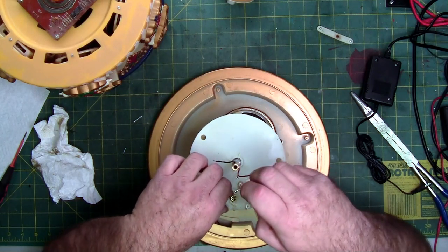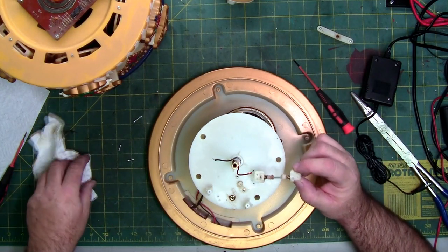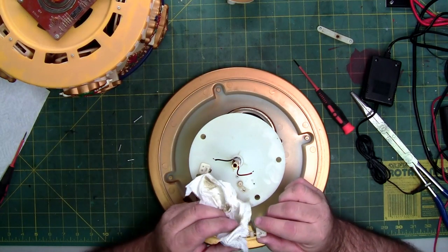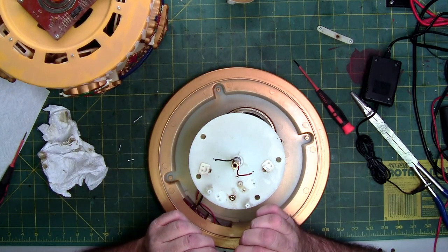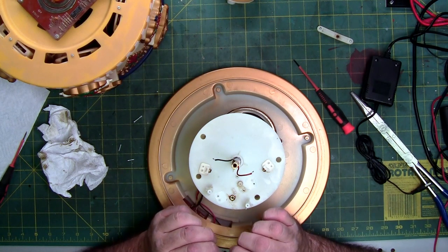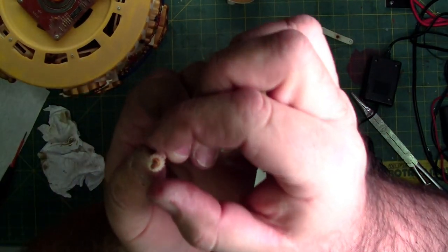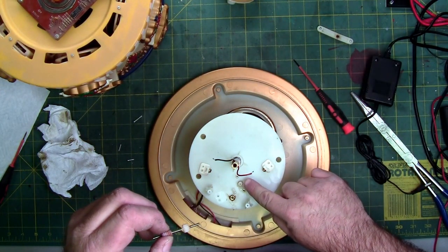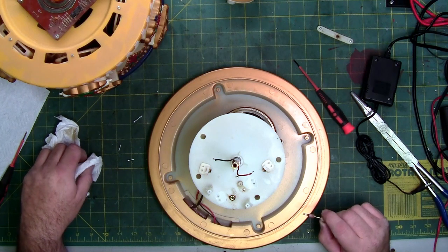Here is the transfer mechanism from the motor: the motor comes up with this worm gear, goes to this straight gear, which goes back to another worm gear that drives a straight gear, which then pulls the pulleys around — and you have your motion. This has a much smaller gearbox assembly than most, which is nice. They use brass bushings on everything — Mr. Christmas is really good at that, at least the older ones. It prolongs the life. This gear has an hourglass appearance from running on the other gear the entire time; no fractures, still pressed on, just a lot of use.